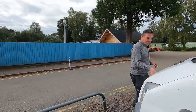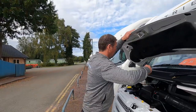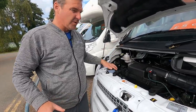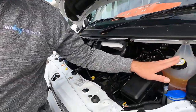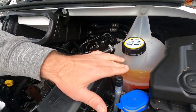A good tip on the engine side is to check all your levels — basically your brakes, power steering, and oil levels. But one of the most important ones — there are actually two important ones — is checking your water level and also checking that you've got sufficient anti-freeze. You can use a little tool for that.